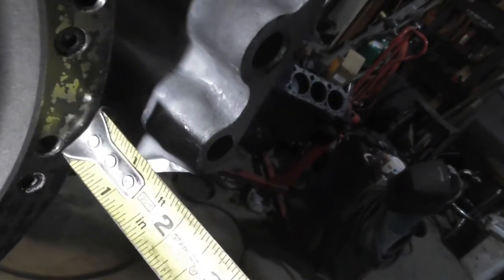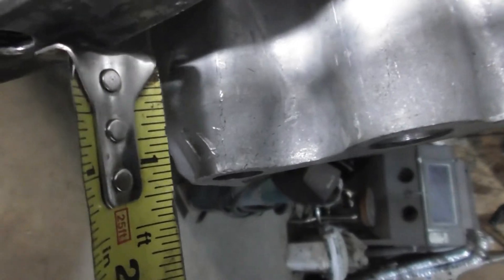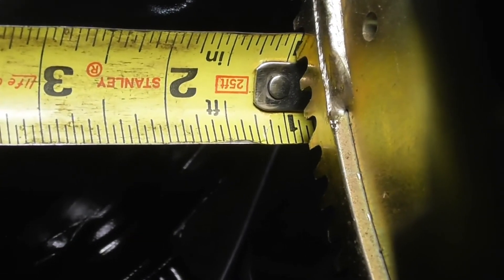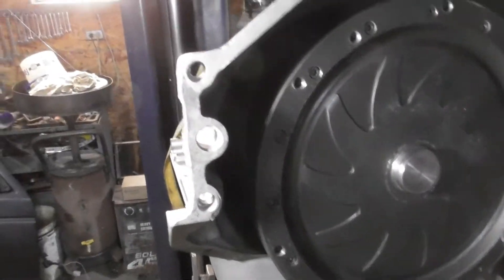It's probably got the converter to go all the way in, but it's having a hell of a time getting that to go in. You're only going to get it to go about three-quarters of an inch — it needs to be more than an inch, which it is now, if you measure the back of the block. It measures exactly one inch. I had to push it up against the hoist so I could get a good push on it to get it to go in. We'll try to get it up in here in a second.